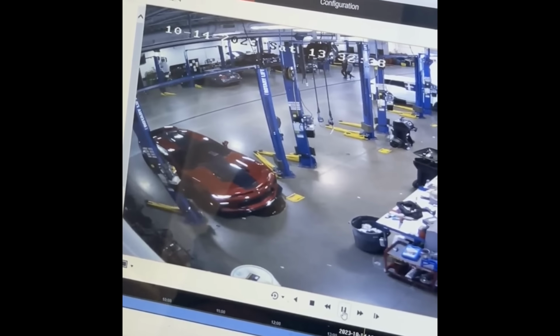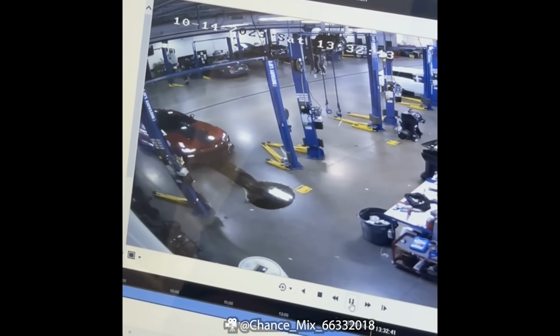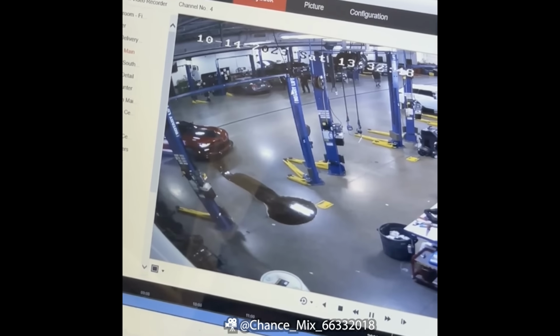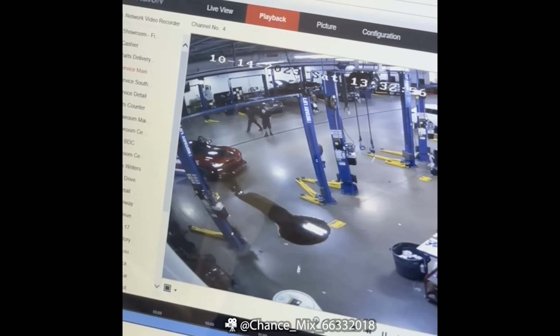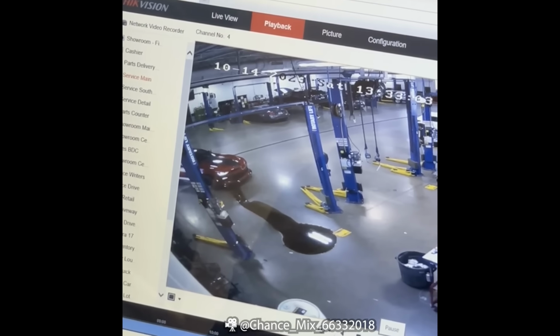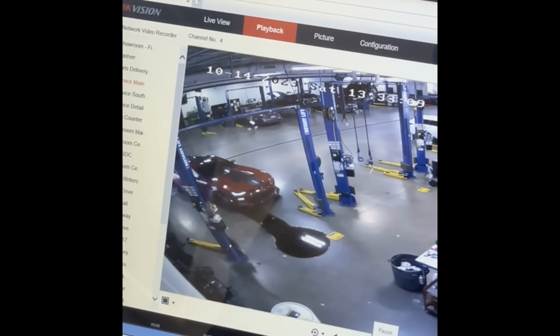The technician performed an oil change on this Camaro and let the car run for 2 minutes. When he backed up the car from the lift, he noticed that all the oil drained onto the shop floor. The mishap occurred when he forgot to remove the old oil filter gasket O-ring, and the engine ran with a double O-ring gasket in place.